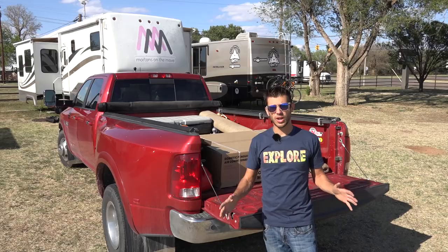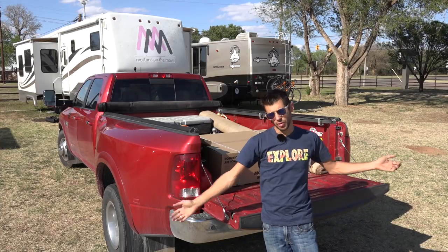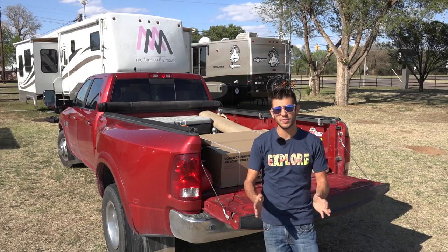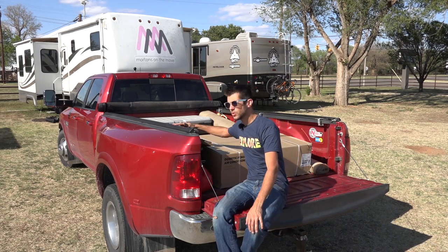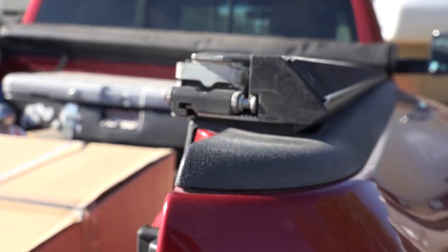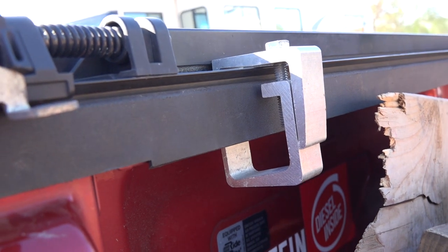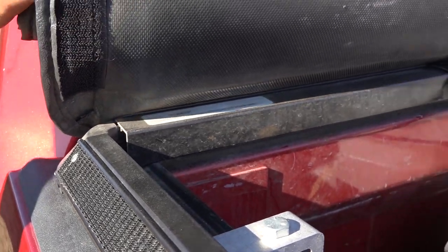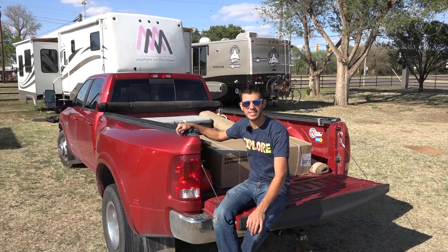You need to make sure those velcro straps are in place or the tonneau cover could roll out, flop open, and flip over to the side of the truck and rip off or do damage to your vehicle or someone else's when you're on the road. Installation of this tonneau cover was really easy. The side rails are all one piece and they just sit on the bed rail of the truck and clamp underneath with big aluminum C-clamps. The tonneau cover itself snaps into the front edge of the truck and all of that just snaps together into the bed rails.